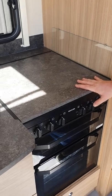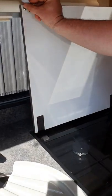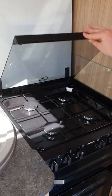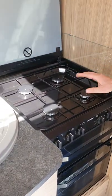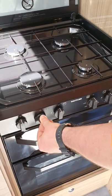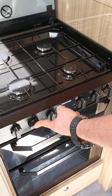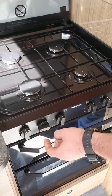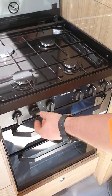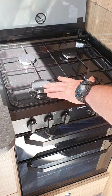This is your range and oven. There's a worktop piece that folds up and clips into place. The glass lid comes up and sits against it. You've got four gas burners — very similar to a barbecue. Push the knob in, turn to the highest flame setting, hold it in, then use the igniter and click until the gas lights. Wait a couple of seconds, let go of the button, and the ring should stay on. Adjust the flame from there, and turn back to zero to switch off.